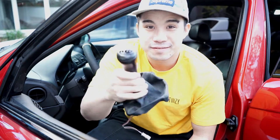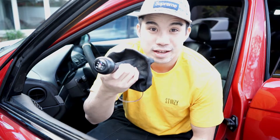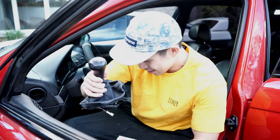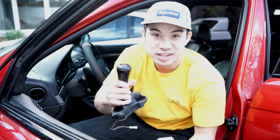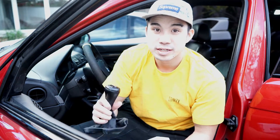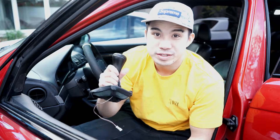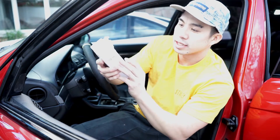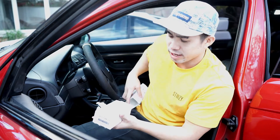Here's the E46 one — I took it off earlier so it was super easy this time. But in order to take it off the first time, I literally stood up on both seats with both feet and yanked it up to get it out. These things are stuck on there pretty good, but just pry away and use all your strength — stand on the seats and you can get the shift knob out of these E39s. This is the new one — just a ZHP knob and it's weighted.